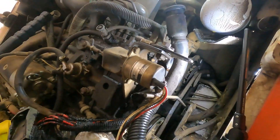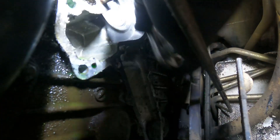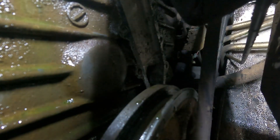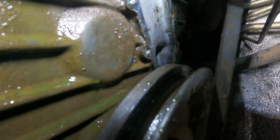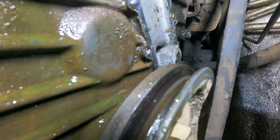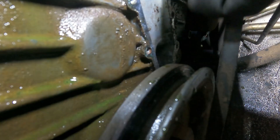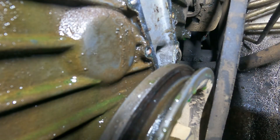I'm going to go get some coolant and antifreeze. I got my non-super scraper, a little razor blade, and I'm going to clean this up. I do feel like it's coming off pretty good. I'm going to take this old gasket off and clean and dry it off with some brake cleaner. I think they used a little bit of silicone gray or black to get this thing on here. I might check to see if there's a thermostat in it, because to be honest, there's a temperature gauge up there and I always assumed the coolant gauge was actually for the hydraulic oil temperature. I ran this thing wide open all day long and never really saw that temperature gauge move except for when this water pump locked up.